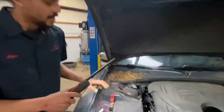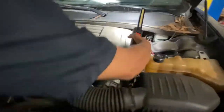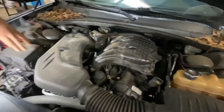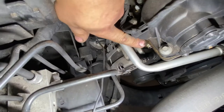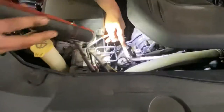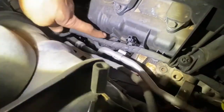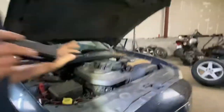Got the car lowered back down. The first thing you want to do is remove the fancy engine cover — it just pops right up. Now take another look at the valve cover. Hopefully you can see that it's seeping oil from around the valve cover gasket. So I know that's one leak. That's more of a seepage. Now let me show you the common issues with these cars.